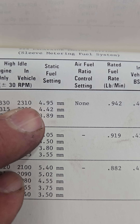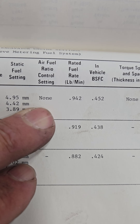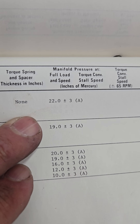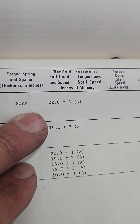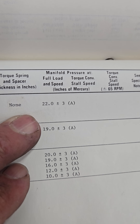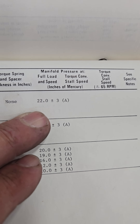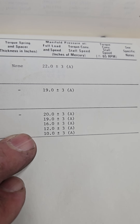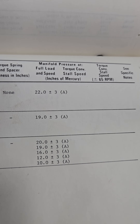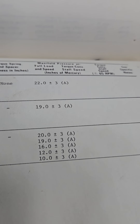We're going to go over to the static fuel setting — if you don't have the tools to measure that, you won't be able to. But looking at the boost, this one at 0 to 10,000 feet should be producing 22 inches of mercury. The rack book does not measure it in pounds per square inch — it's all in inches of mercury. So basically, dividing that by two, it's about 11 psi boost is all you're going to get.